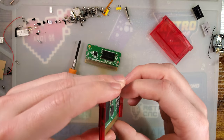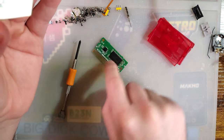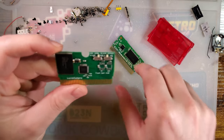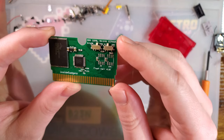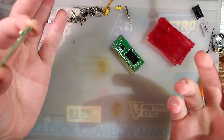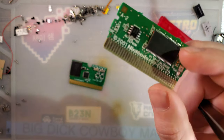It actually has two switches on the motherboard and two spots for memory modules. I only have a 4K donor right now — I don't have a 64K module to pop on here. But for what I plan on using this for, 4K should be fine. It is worth noting that 4K and 64K are not interchangeable. The games are programmed to use a specific save type, and if you don't use that save type, then it's not going to work. Hence why it was giving me that EEPROM error.